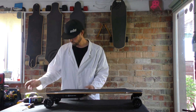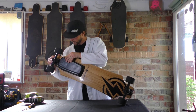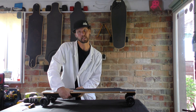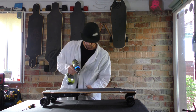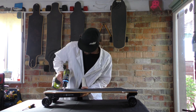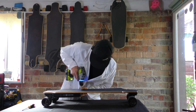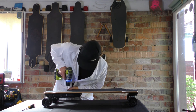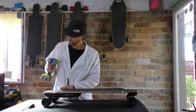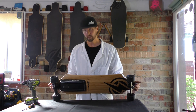Make sure everything's nice and tight, wiggle on it. Make sure the actual casing is nice and tight. I'm looking on here and I can see a couple little gaps, so make sure your torque setting is adjusted well — that's sucking it up nice and tight. Our waterproofing kind of depends on that, so you don't want to back off on that too much. A little less than halfway on my torque setting there, and there you have it.